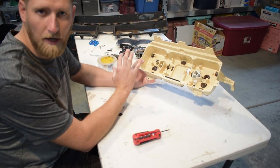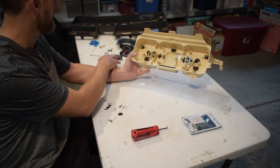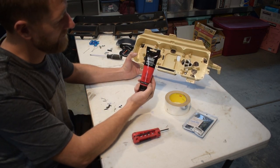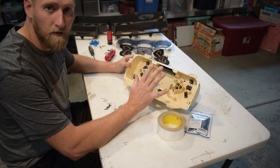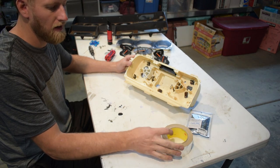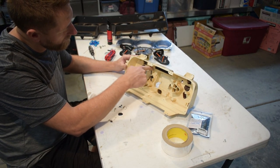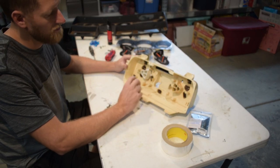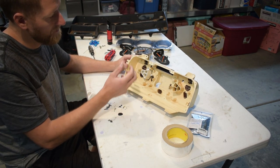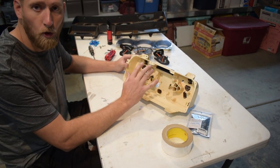We got everything cleaned out pretty well. From this point forward, everything I use I'll have links in the description below. I've got these new LED bulbs, this aluminum tape, and then when we repaint the needles I've got acrylic paint. Before we replace the six bulbs, I'm going to use some aluminum tape — the kind for HVAC ducting — and put a strip all along the outside perimeter. The lights shine back behind the gauges and flood out around them, so this aluminum tape will allow that light to flood more evenly.